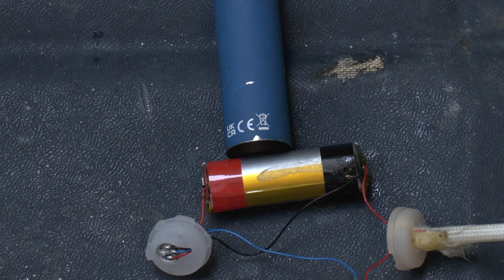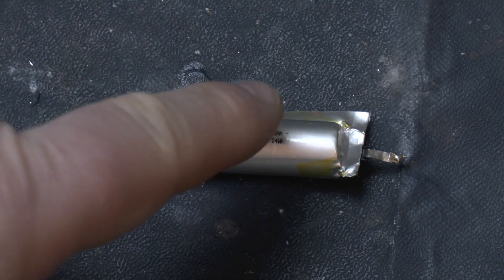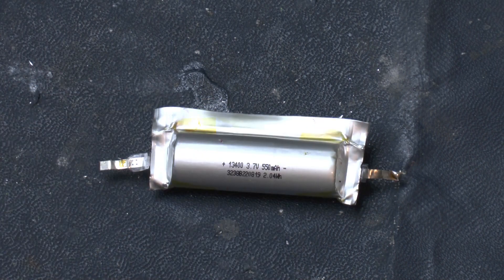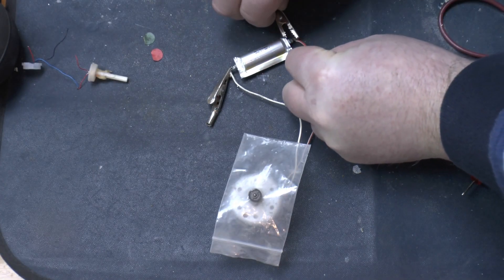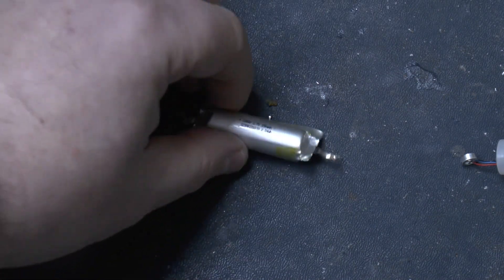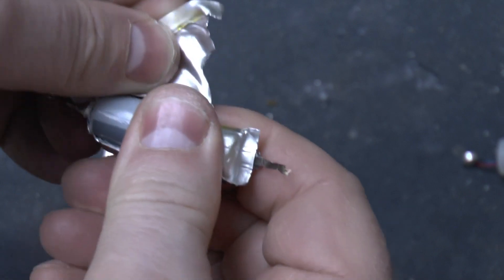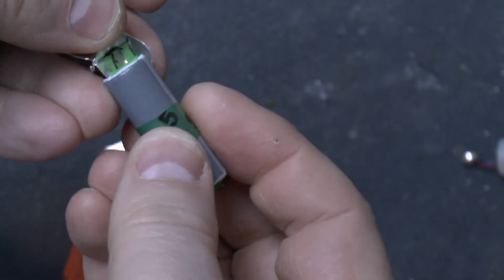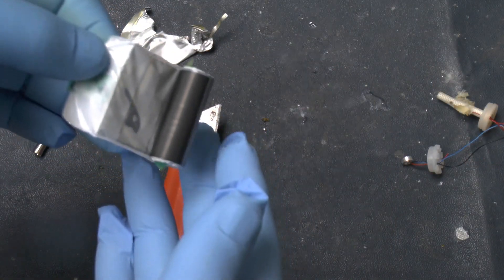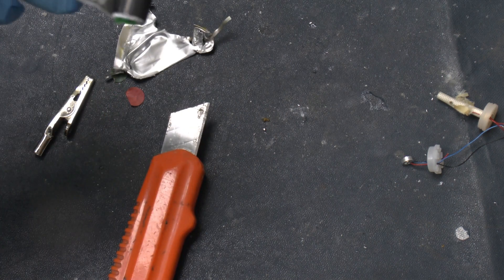Let's disconnect the battery and see what we've got. The battery is interesting because once you take off the tape that was binding the ends, it actually unfolds to appear to be a cylindrical cell in a foil pouch. The trouble is I've fully charged it now, which means I've got to discharge it. That took an overnight run but it's now flat so let's take a look at what's inside. There is a cell inside after all — at least we've got liquid in there. I think that's the actual electrolyte of the cell. I think it's an actual spiral wound cell, just in a foil pouch instead.